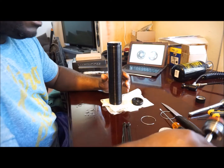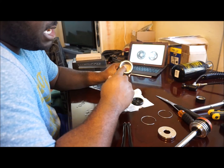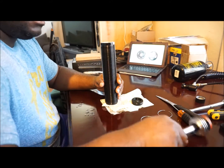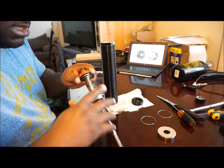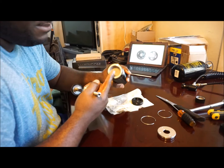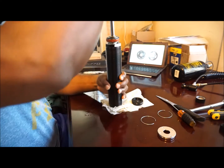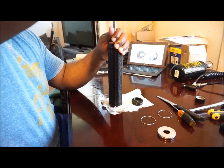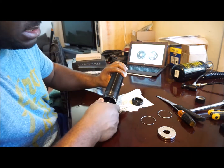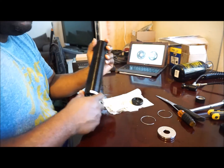Okay guys, what we have here is the shock body; the sliding piston I have placed inside, concave side facing up — this is the top of the piston. We have our shock shaft with the piston on the shock shaft, and I'm going to show you how to piece it all together. I put the sliding, or dividing, piston in like so, and I'm going to go ahead and put our shaft up against it and just tap and wiggle it in — no oil. This is simply for the purpose of getting the dividing piston positioned between the shaft nut and the butt plate of the shock.